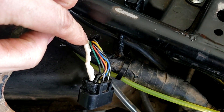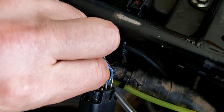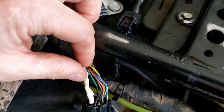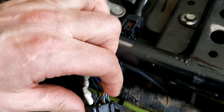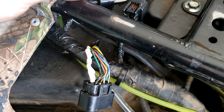Just a little update. Both ends of that wire — that joint — were broken. So I had to splice a piece of wire in the middle, doing a joint there and a joint there. I put some shrink wrap on it. Hopefully the rest of the wire isn't too brittle. This is getting crazy — I'm just going to have to tape all this up so it doesn't move too much and get any more corrosion in there. What a pain, man.